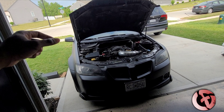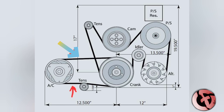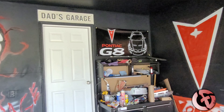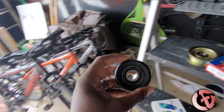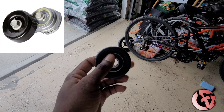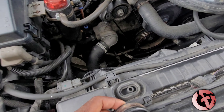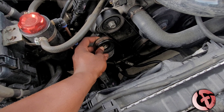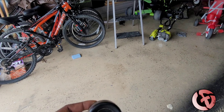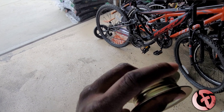So this right here is the G8 GT model, the L76 — also known as the LS2. We've run into an issue where the AC belt slips off. Your AC belt goes all the way in the back and comes around just like this. This particular piece — you guys have seen it — your belt runs on the back of this. The issue I found, the reason why these belts come off so easily, is that once this belt sits on the back of it, it slips — as you can see, there are no guards, nothing at all.